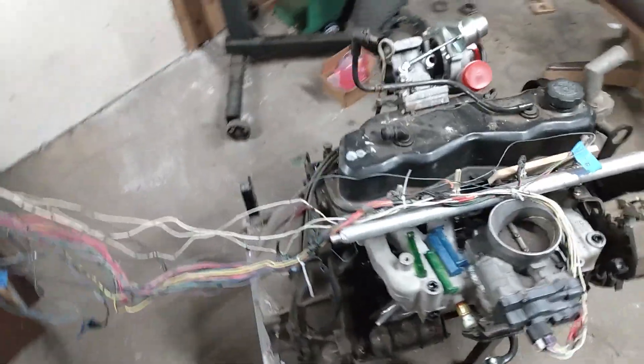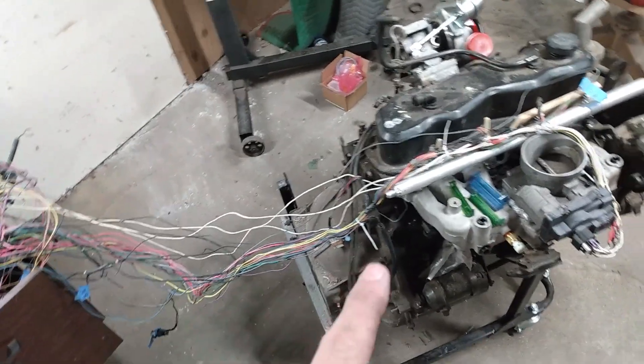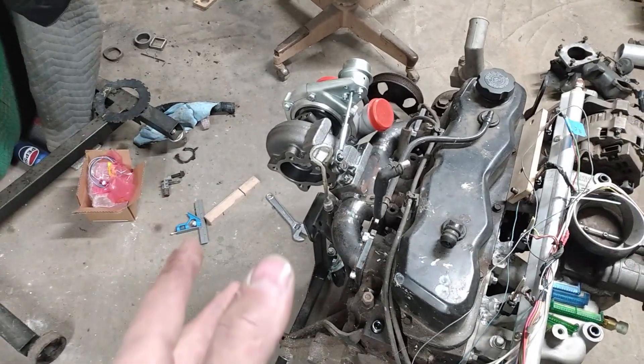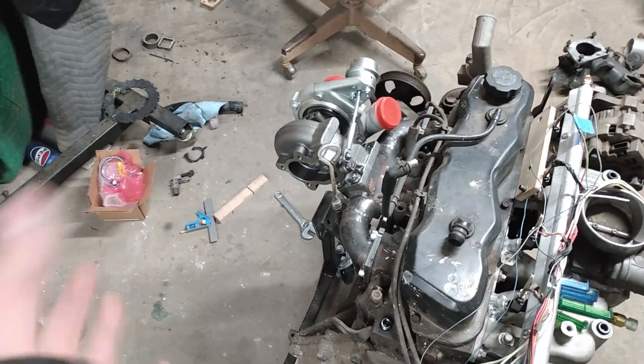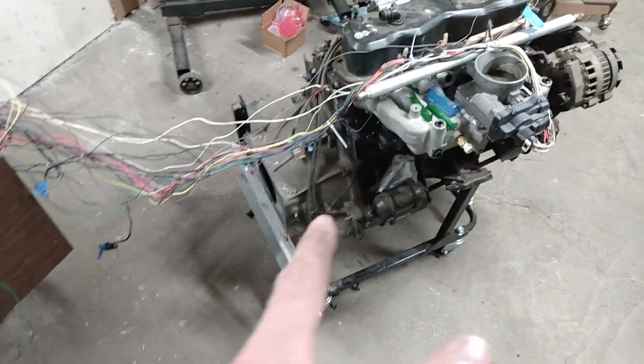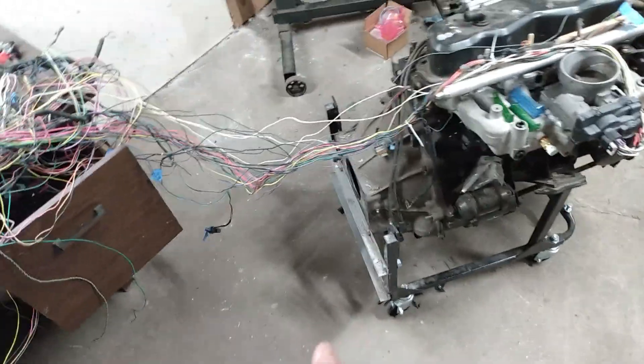We've pulled out everything I wanted to pull out. We got all the O2 sensors out but one — I found a guide online that said I can tap the signal from bank one and put it into bank two, so I'll still have closed-loop working. We're only going to have one exhaust coming off this thing coming off the turbo, so we'll put one in for the narrow band and one in for the wide band, and that'll be it. Transmission stuff is all pulled out too, because we're just going to use either a T5 or if I can find one, an NV 1500 — they came in the 2.2 S10s. I still have to route everything nicely, but this really isn't that hard.